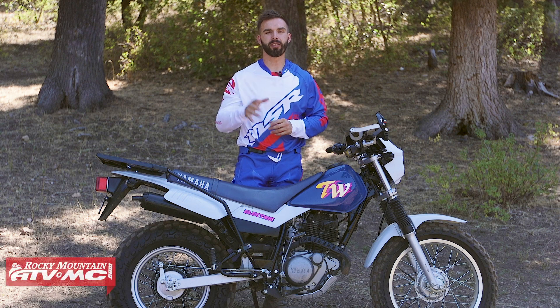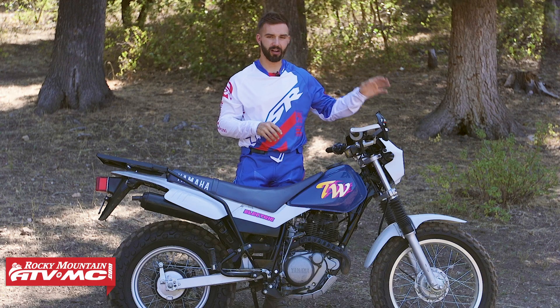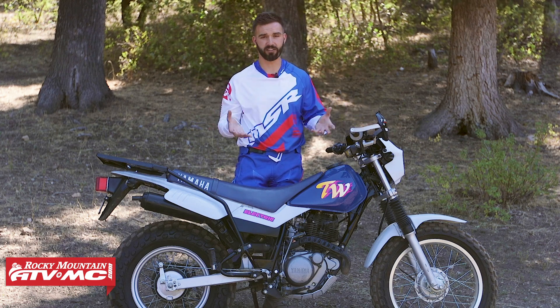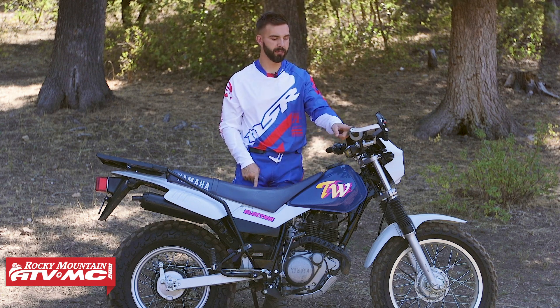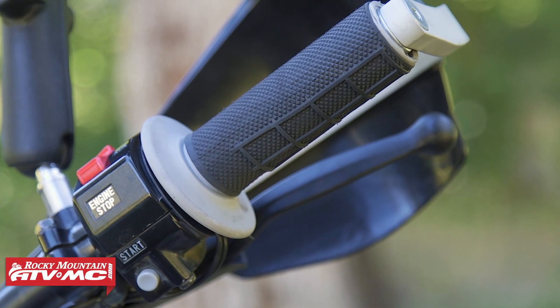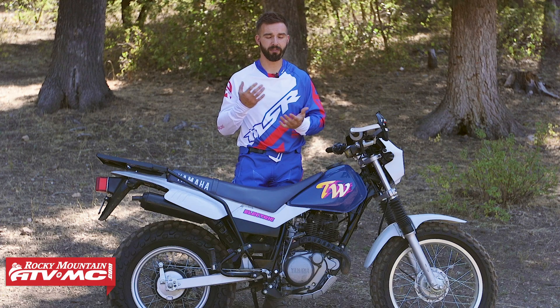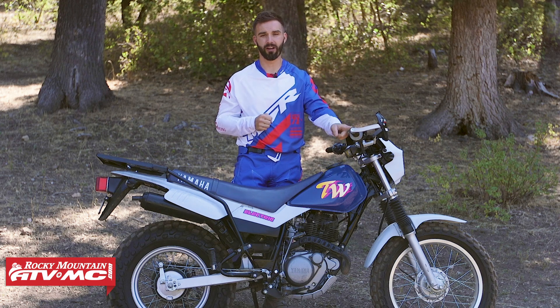The fifth and final item is comfort. No matter what bike you're riding, if your hands are cold it's not going to be enjoyable. This is where the power savings from the JNS headlight really matter. I've got the Tusk Grip Heater Kit installed — they're universal fitment, so you just wrap them around your handlebar, install your grip over top, wire it up, and you've got high and low heat settings. They do a great job keeping your hands warm, so if you don't like riding with cold hands, the grip heater kit will solve that.